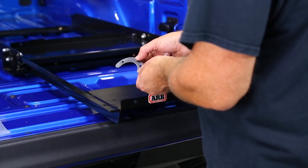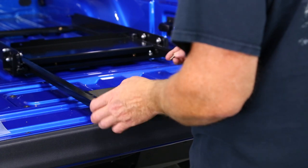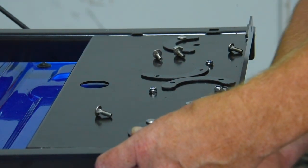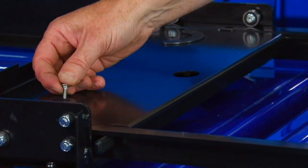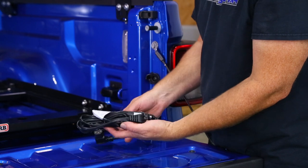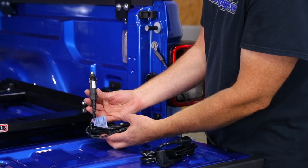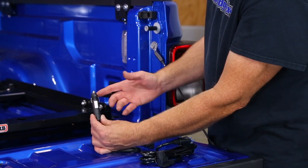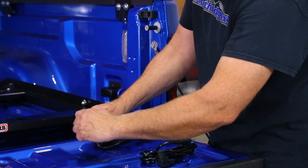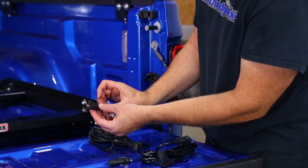With the Elements slide, we have these little locator plates that bolt right onto the top of the slide, and this allows the feet of the Elements fridge a place to lock into. With your ARB fridge you get two cords - you get your 110, and you also have your 12/24 volt for the vehicle power. If we look at the end of the 12 volt cord, this end is designed to slide into a cigarette lighter or auxiliary power socket, but it's not going to fit the ARB surface mount socket. What you want to do is unscrew it - then this will plug into the ARB surface mount socket.